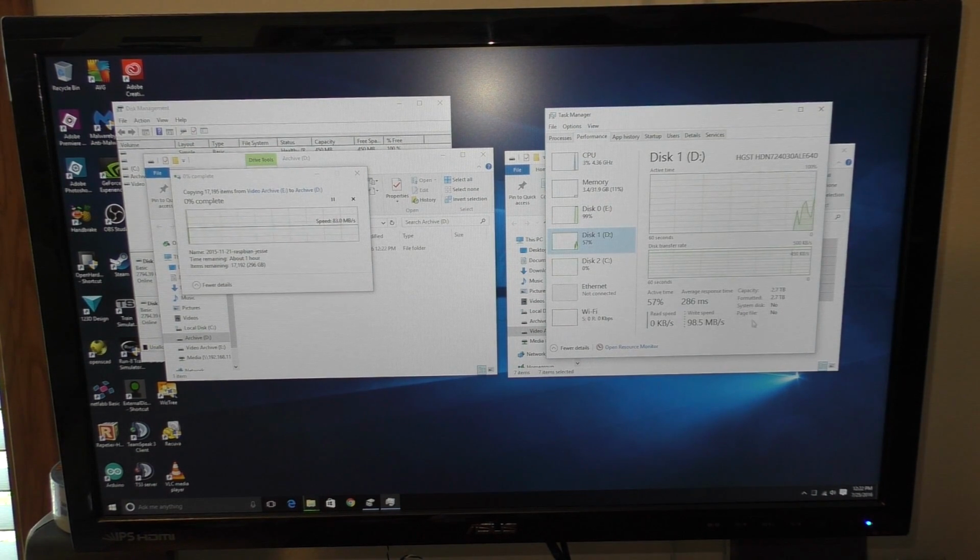And of course, right now, on the 7200 RPM drive that we just installed there, the HGST one, we're going to be on the very outside part of the platters, which means that that drive right now is going to be really fast. By the time we put 300 gigabytes on it, it's probably only going to be slightly faster than this drive, but we are going to test it. Anyhow, you can see this is the new drive, this is the old drive. The old drive is just maxed out at 100% active time. This other one just kind of bouncing around here.